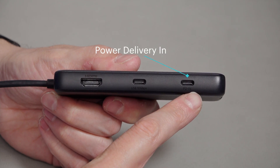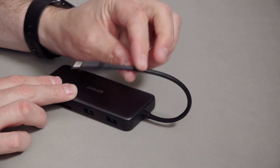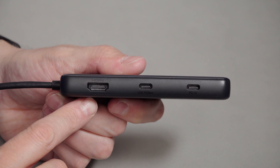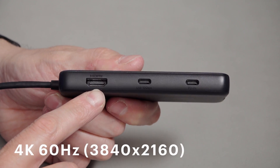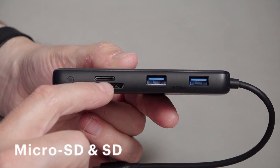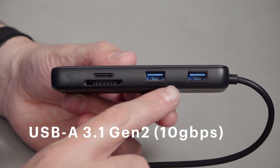Obviously it doesn't require power, but you can provide power back to your laptop. It has a dedicated port here which is power delivery in. So you can take your standard laptop charger, plug that in, and it will provide power back through the USB-C cable into the laptop and charge it. Going around the device: there's an HDMI port — 4K 60Hz maximum. I've connected it to my 5K monitor, and it works at 3840x2160 at 60Hz. Then there's a 10 gigabit USB-C port, the power delivery port, microSD, standard SD, two USB-A ports — both also 10 gigabit per second — and on the end, gigabit Ethernet as well.